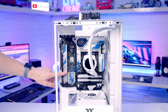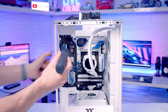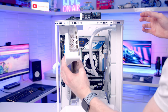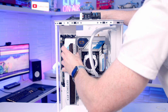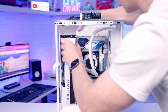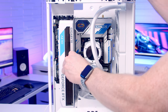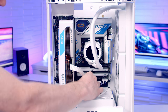Next I want to get the graphics card installed before the top and rear fans. Remove the first and second expansion slot brackets, open the clip on the PCIe slot, and slide the graphics card into the case. Line the graphics card up with the slot, apply firm pressure and it clips into place. Secure it with the two thumb screws at the top. Bring the 12V high-power cable through, line it up with the graphics card, push into place, and pull the excess cable through to the back.